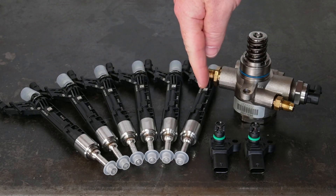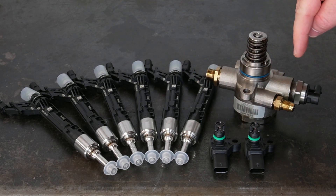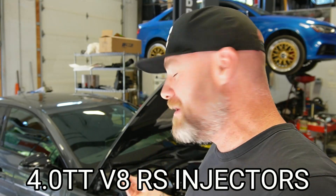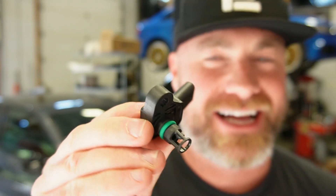Here are all the parts we're going to be installing today: we have six direct injectors, two four-bar map sensors, and a high pressure fuel pump from APR. These direct injectors are the OEM injectors from the brand new RS7 and they swap with relative ease into this motor. The part number is written right on the injector — I'll also put it on the screen. It's also listed on Integrated Engineering's website under the Stage 3 Plus profile, where you can see the different parts needed.